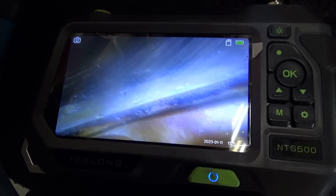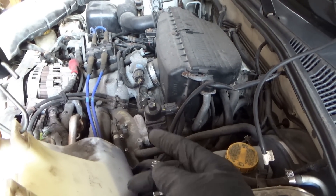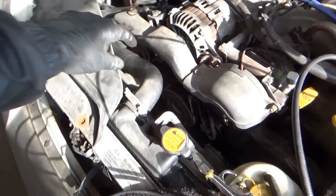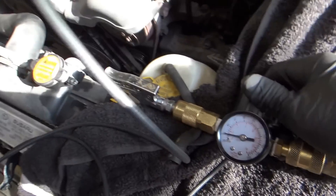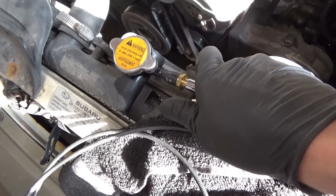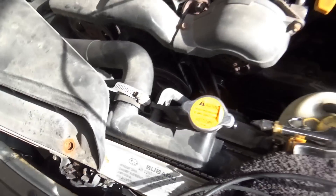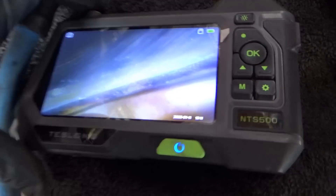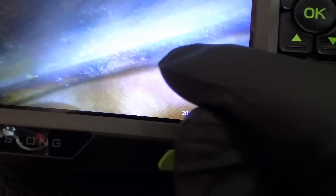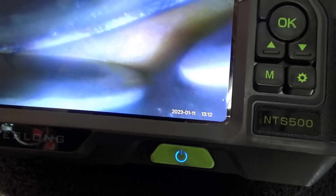The crack usually develops on the upper side of the cylinder liner, kind of by the intake valve, towards the front of the engine. What I'm doing here is pressurizing the cooling system through the overflow pipe with my regulator set to about 20 psi — the radiator cap is keeping pressure inside the system. The hose is nice and hard now. What I saw was coolant slowly weeping at the head gasket surface. You can see the cylinder itself looks extremely clean, like it was steam cleaned — so this is definitely our issue.